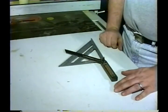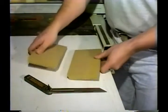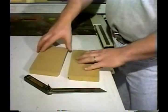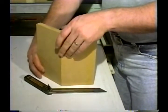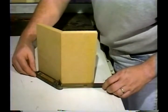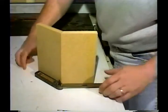Now, when you are mitering two pieces of wood together and want to butt up the two against each other to get a perfect fit, simply find the angle you desire and divide the two, and that will give you the degree of pitch that both pieces should be cut. For instance, if a 45-degree angle is what you are trying to achieve, then the two pieces cut at 22.5 degrees will equal 45 degrees when the two ends are butted up against each other.